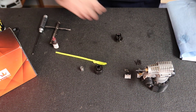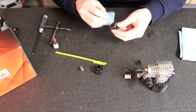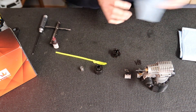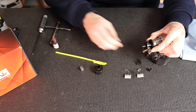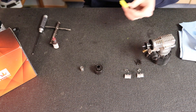I'm going to do the flywheel the same way — clean the contact areas with motor spray and a folded paper towel, just to make sure there's no oils or anything in between that would inhibit the stick of the flywheel to the collet. Again, I'm going to pull the crankshaft out and pull the flywheel back and make sure there's no play in there.